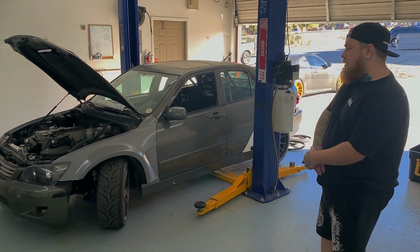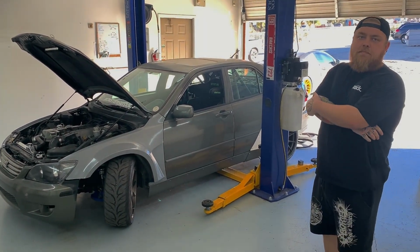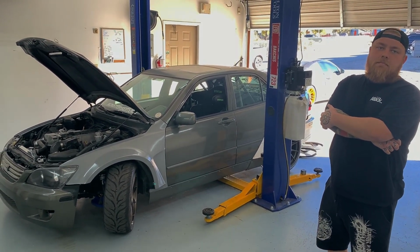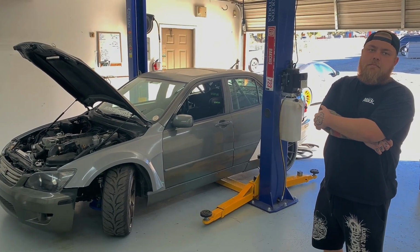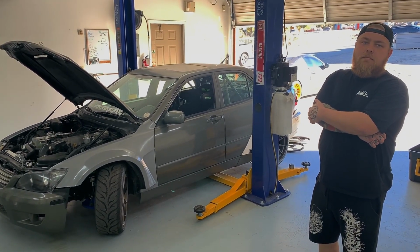The location of the rack from the factory is not what we choose. But it's kind of for the Ackerman curve and everything, and also for the wheel not hitting the tie rods. You need to do something. So yeah, it's what it is. If you can relocate the rack, that's obviously a lot nicer.